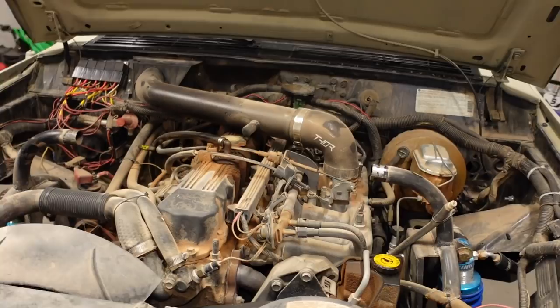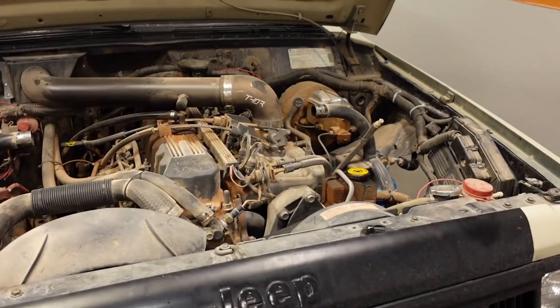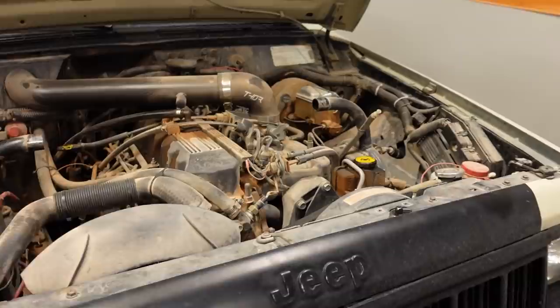So the existing exhaust system starts right here below the intake with the stock manifold. He's worried you might have a couple of small cracks on there, but we're just going to start from scratch and replace it with a header, and I'll show you all the parts in a second. So today's job: manifold off, header on, and we'll weld a V-band onto the header instead of the factory style connection. And then the rest of the exhaust, I'll show you down here.